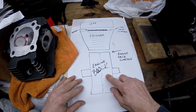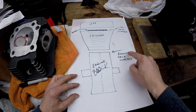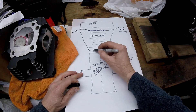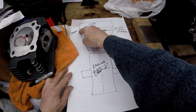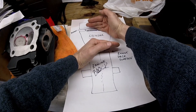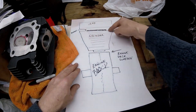On your engine block, it's very important that where the two case halves meet, the surface has to be very flat because the cylinder mounts there — you'll have leaks there forever if the deck surface isn't flat. That's called the engine deck surface. The cylinder base also has to be flat, and don't forget you have a spigot that sticks out and goes into the engine block. The cylinder deck surface across the top also needs to be flat and 90 degrees to the cylinder bore. Make sure you use a reputable shop that checks both surfaces and bores square to them.